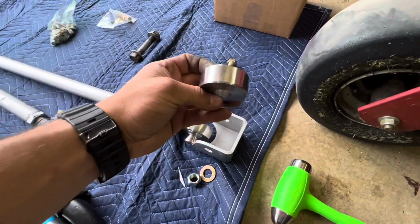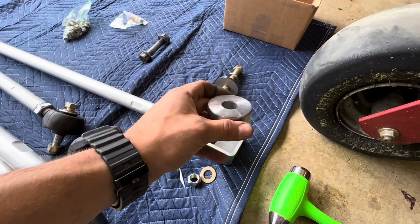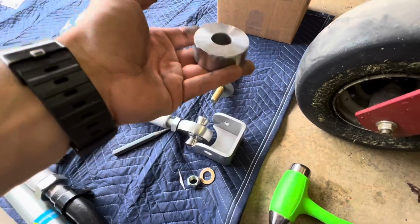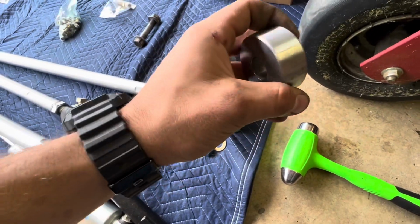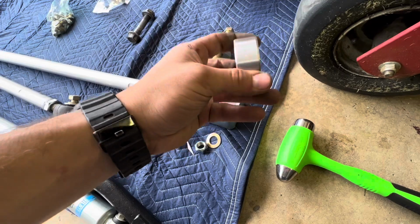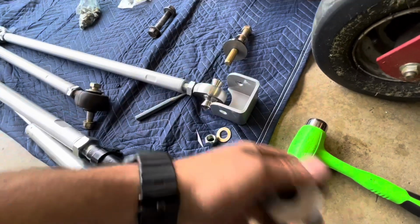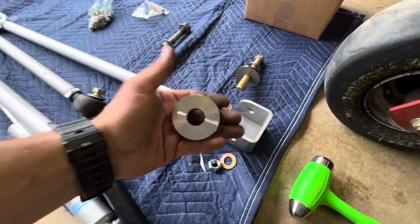Taking it apart, you got this little guy. It's kind of like a bearing, I guess, but it's like a spacer. It's going to be pretty much a press fit into the axle where the ball joint was, because obviously a big bolt, big washer, it's replacing that. So we're gonna go pop this in the freezer, leave it in there for a few hours. Make sure I took a little Scotch-Brite to it just to clean it up, make sure it's all smooth and silky. So yeah, we're gonna go do that, and then we'll bounce back to the track bar drop bracket.